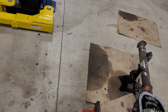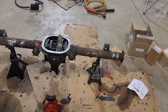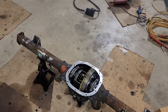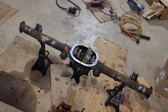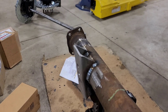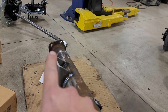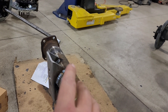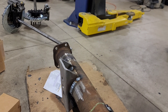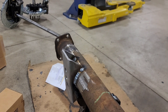From wheel mount surface to wheel mount surface it should be the same. I measured and narrowed it by 1.4375 inches on both sides — cut the end off, weld the back on, by 1.4375. Just a note: I had someone do it and they messed up one thing — these brackets are directional, and they got put on backwards. The caliper rides on the front, which is fine since the bleeders are still the highest point, but the downfall is you won't be able to run a cable to the caliper for your e-brake.